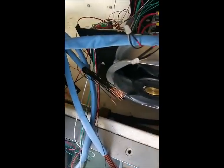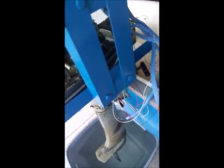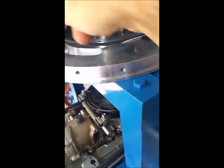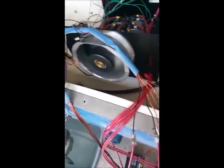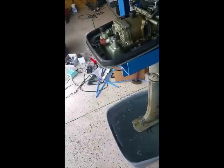We've got the fan on right now running off of this little battery. This is the timing setting for that one — this coil right here, and this will be for the other one. What I'm going to do is hook up this negative to there, just holding it down right now with my hand. It's not very wise to do this, but I'm just going to put it right here and see some water splash. It goes, definitely. We have some firing here taking place.